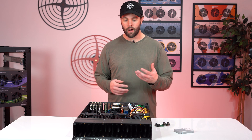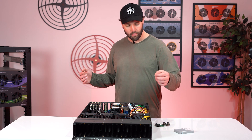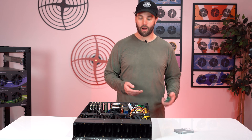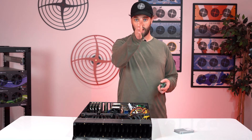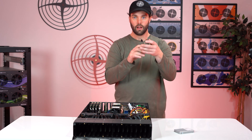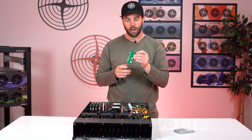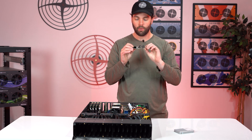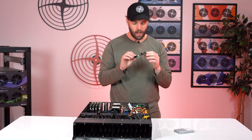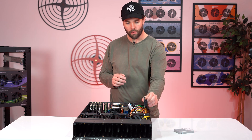Let's talk about the electrical side: power distribution, the data path, the backplane. We've learned some things from our past backplanes, and to maximize airflow, we changed the orientation of the backplane so that drives plug in inline with airflow, allowing air to flow right past them. Built on the same UBM technology as the 32-bay machine, we now have an individual backplane port per drive.